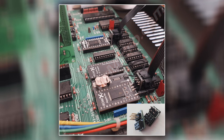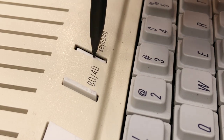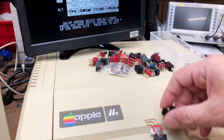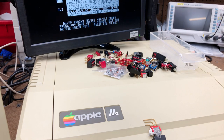If you have the Euro or international version of the IIe, you'll want to check your main board to see if you need the ROM link riser option. Some versions of the logic board place the RAM too close to the ROM socket, so the riser cable won't fit. One of the coolest new details is the use of the keyboard switch on the Apple IIc and International IIe machines — flipping the switch allows you to access the second bank of text fonts built in. If you have the North American IIe design, you'll have to do some soldering work to get easy access to those extra fonts.